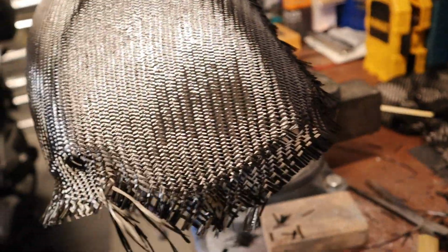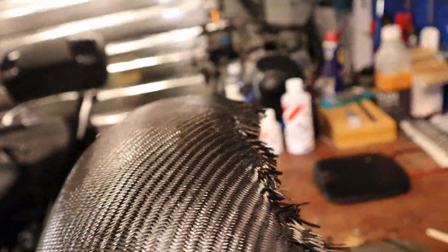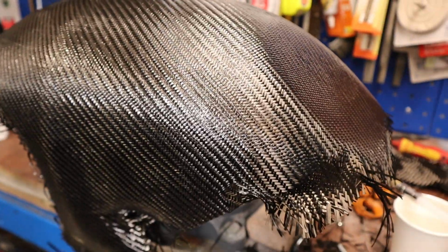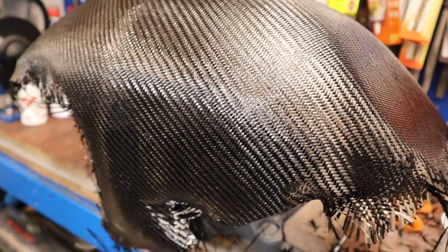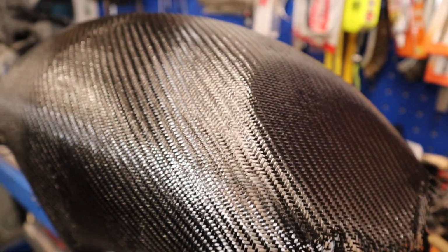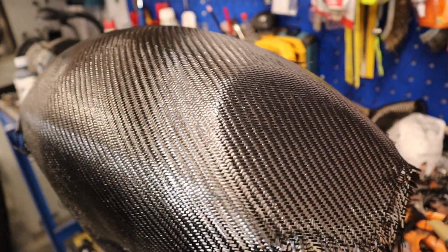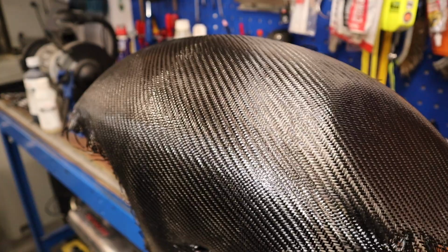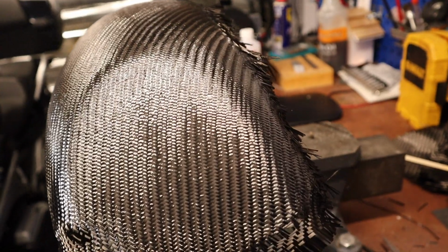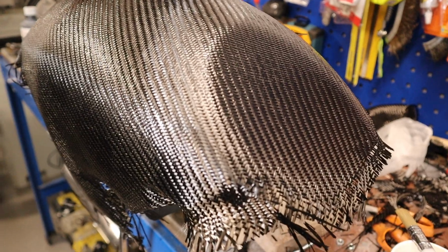I hope I've got no fibres in the actual surface. So that stays for 8 hours now, overnight, before we sand it down with 120 again, believe it or not. What begins to look quite good is then sanded down. And all this job is about is sanding, resin, sanding, resin, sanding, resin, with finer and finer sandpaper. Then when it's all done, it's polished with a cutting paste, and polished and polished and polished. It's almost a 5-day job.